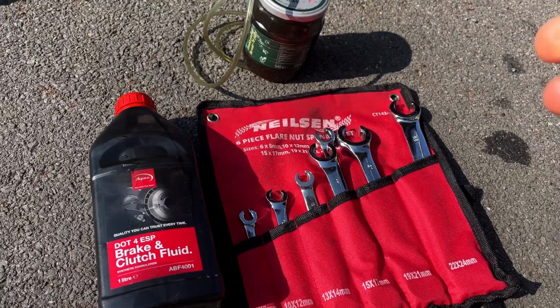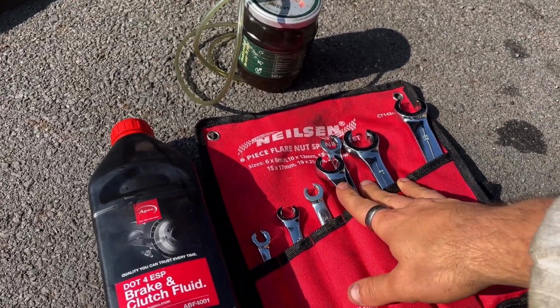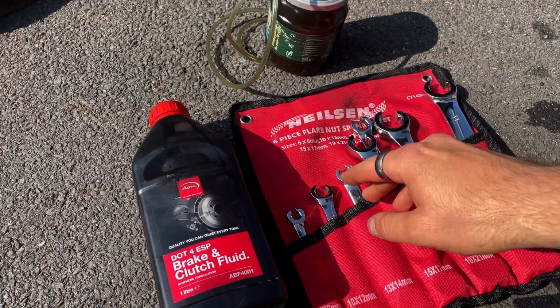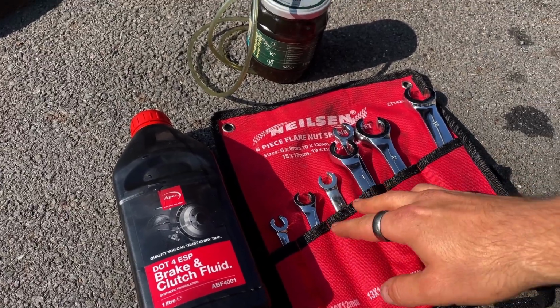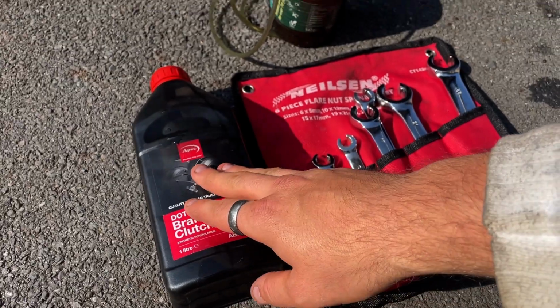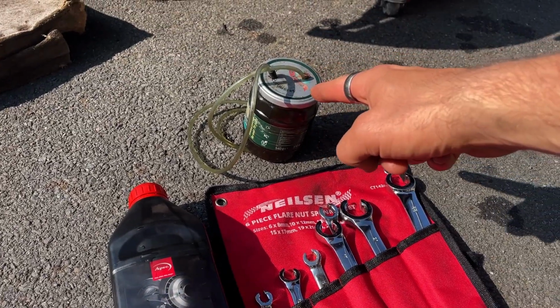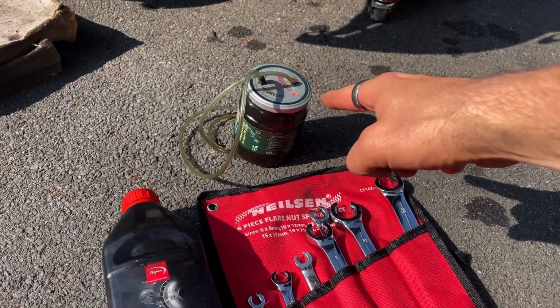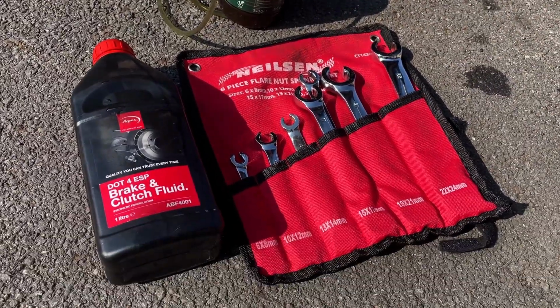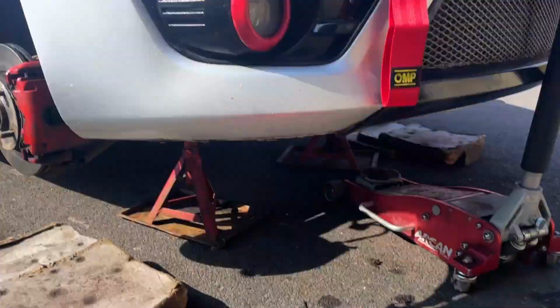And then the other few things is there's about 3 things you're definitely going to need to do this job on the driveway. You're going to need a decent flare nut spanner set with particularly a 13mm and an 11mm, because that's the size of the flare nuts on the ABS pump. Some brake fluid, can't go without that. And also a bleeder. I do have a video on my channel if you want to make your own homemade one like that. But other than that guys, let's get stuck in with changing the ABS module on a Mark 6 Fiesta.